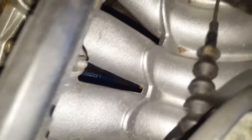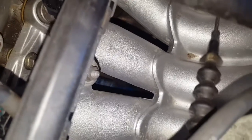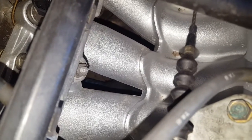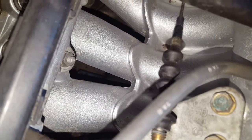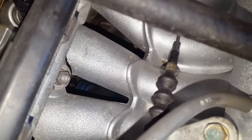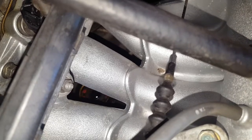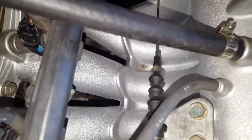Okay, so what I did was position the oil collector underneath it, broke it free from the bottom. Now I'm going to finish turning it off from the top. Make sure to catch it once it's fully unthreaded. And the face that goes against the block or the motor, you're going to bring that up. You'll see. Just like that. That way the oil that's still in the filter will not spill everywhere as you're pulling it out. Okay, so there we go.